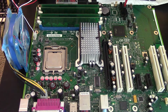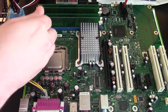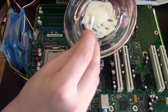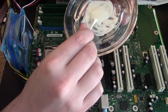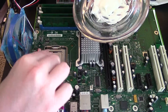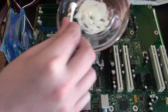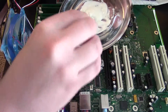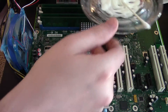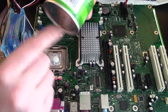On the motherboard I switched the system fan and put it onto the CPU fan so we don't see fan errors — you may have to turn detection of the system fan off. We're going to take a little bit on the tip of the Q-tip. Since there's a small divot in the tin can we may have to make a bigger glob so they make contact. If you have a flat-bottomed can you don't need that much, but this one has a divot so we need it to connect.